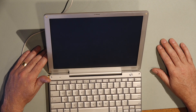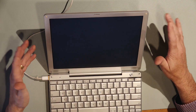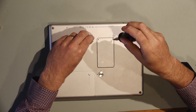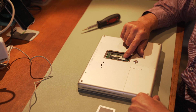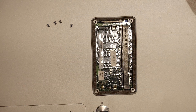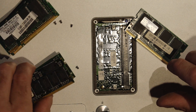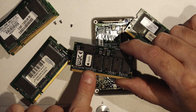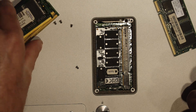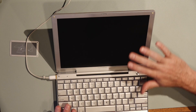Nothing much is happening. I've tried turning it off and on a few times. I've tried resetting the PRAM. It still just turns on, chimes, and the screen backlight comes on with nothing else on screen. I'm going to pull off the RAM cover because maybe it's a RAM issue — it doesn't hurt to try and it's the easiest thing to try first. This is our RAM stick and it is a paltry 256 meg stick. I'll see if I've got a bigger stick. In my collection of RAM, I've got a bunch of 256 sticks and four 512 sticks, one of which is Apple branded. I'm going to try booting into open firmware mode to see if we can get the screen displaying anything. We are in open firmware mode, so I know the screen works — it just doesn't want to boot something.